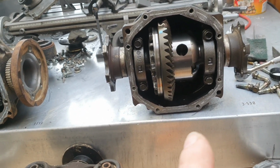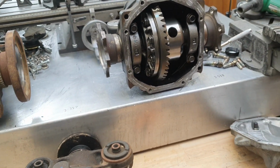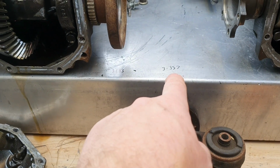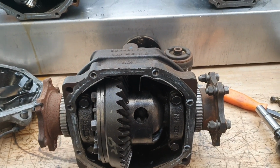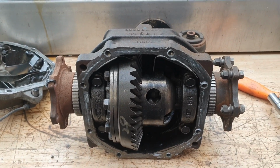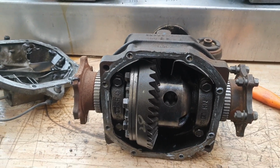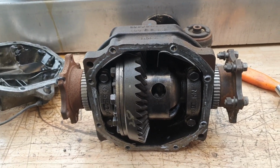However, it could find its way back into the car for Leadfoot potentially, or things like that. The auto diff, that's got a ratio of 3.357, and that would get us to 24-something, I think it is, kilometers an hour, which is better and not terrible, but still not quite fast enough. It's still going to strangle the car. We're going to accelerate quite quickly. We're going to get to that 224 kilometers an hour pretty quickly and run out of revs, and we're sitting on the rev limiter for long periods of time, especially at Pukekohe, right?